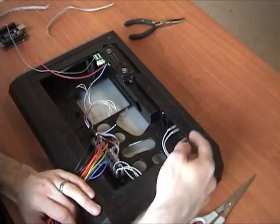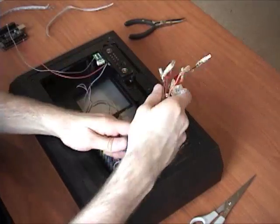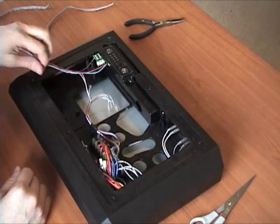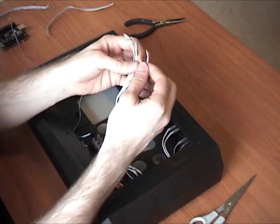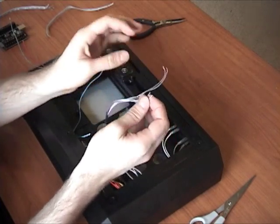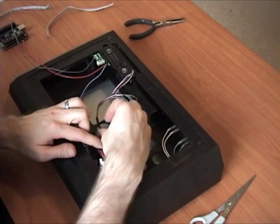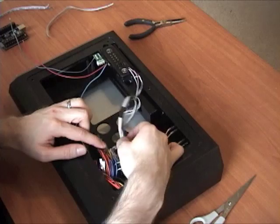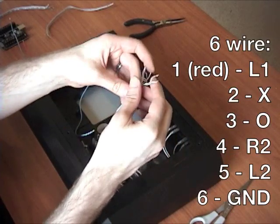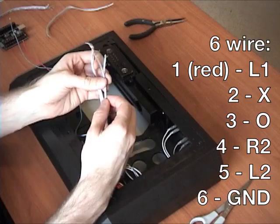I have start and select buttons connected back up - you probably never disconnected them, so you won't need to do that. Just curl up any extra stuff and tuck it back so it's out of the way. If you're going to split all these ribbon cables so you can easily connect them, you can pull the ribbon cables off - you won't get them mixed up because one has six wires and one has five. Get them like this and I will put on screen which wire goes to which one, based on this red stripe that you can see.